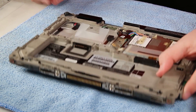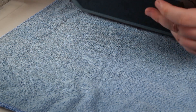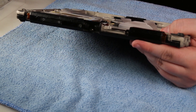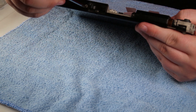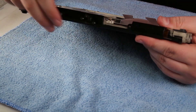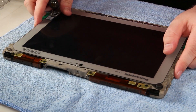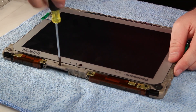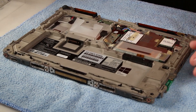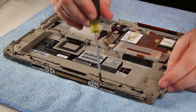Go ahead and remove the top cover. The front piece that's underneath the top cover — you'll need to remove that as well. Then you can go ahead and set it back down on the screen, and remove all the screws holding the bottom base cover in place.